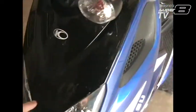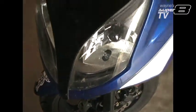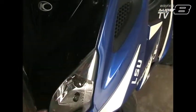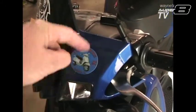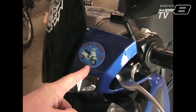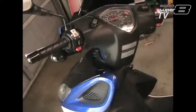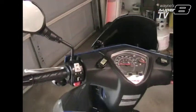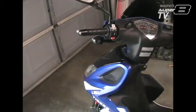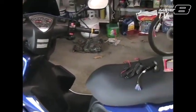This long piece here has to come off on each side, and then you have to unscrew all this stuff here to separate those two pieces. Take off this front V piece that wraps around with a nut underneath, and then the whole headlight assembly will come off. In order to get it wired up, I'm going to refer you to some old videos where I took apart a lot of the panels. When I put these Trail Tech items on, you can find that video of getting this top section taken apart too.